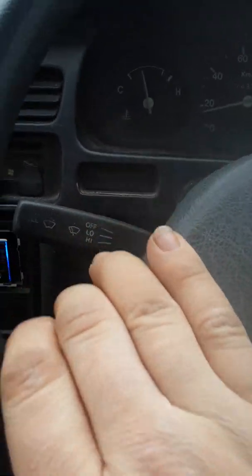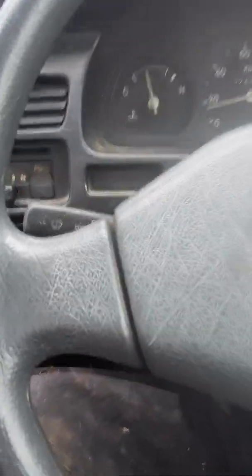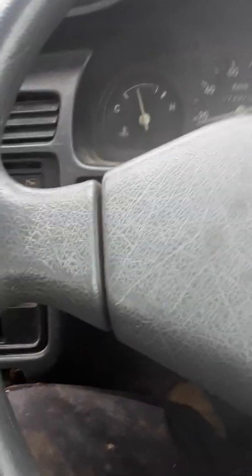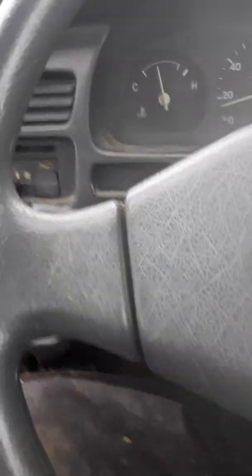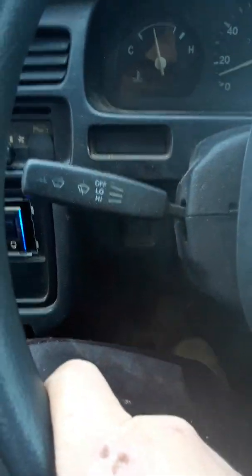It kind of depends on the lean. Having a hard time with the passenger side tire — it's got a heavy lean that I can't seem to take out. I've tried adjusting everything up top, keep adjusting the front end, and I get it close enough to do all my speeds, but it's still not perfect. Once I find the right tie rod ends and put on the originals, I'll take it into a shop and have it straightened out. There's no point trying to fight with it.